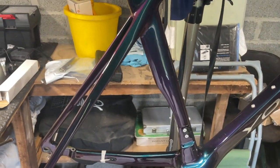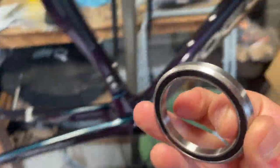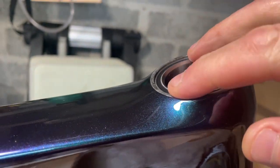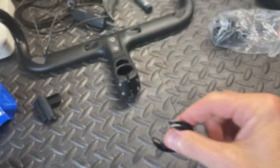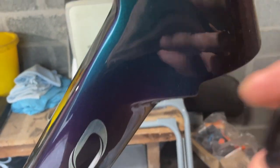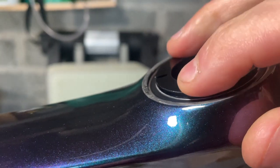I've noticed some things I'm gonna have to get around before I start. We'll take the bearing and put it into its place. As you can see, that bearing sits lower than the surround. We've got the split compression ring which is raised, and that will bring it up above where it needs to be. Let's put the split compression ring in and we can see that it now sits proud.